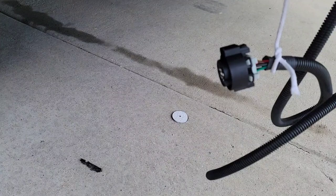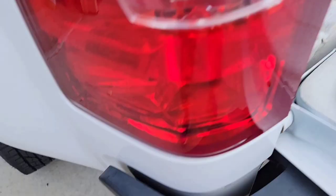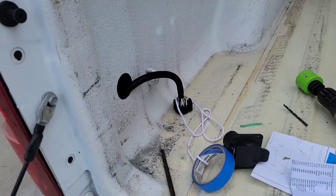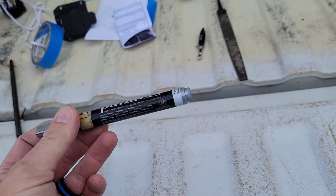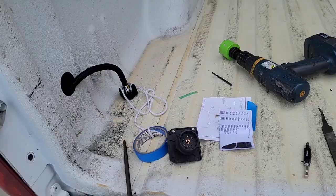We're not tying a boat anchor here — I got some cotton thread, actually clothesline you might use when camping. Tied it around this end, got it up here. All I'm going to do is pull it up through and hang it on the edge. So we got our string pulled up through here. I went ahead and filed the edge of this hole down. If you guys don't have these paint pens, just go grab them at Walmart — they're super cheap, or you can get them off Amazon. It doesn't matter what color because it'll be hidden — you're basically just sealing that metal. If you want to put some dielectric grease, you can put it on here or on the connector. We'll slide it in and get it done.